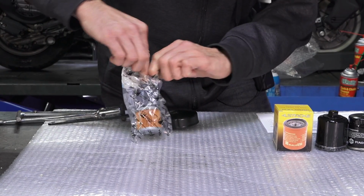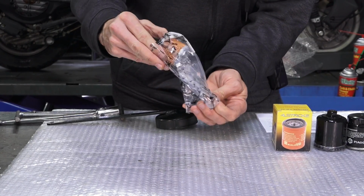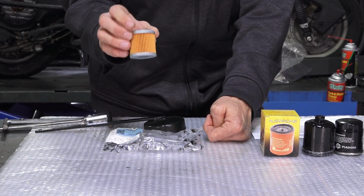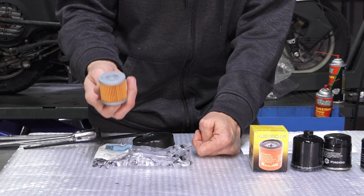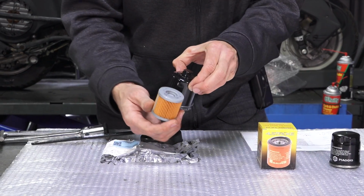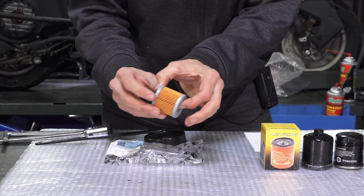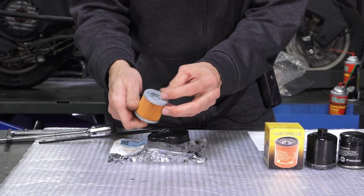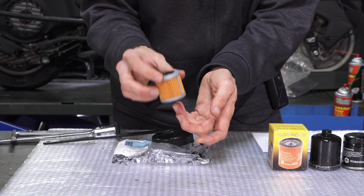Part number for this oil filter is A80887, and it's located behind a cavity or little aluminum door that's held by usually 3 screws on the BV350, and in some cases even a threaded cap. So essentially this is what's inside a filter like this. It's just the cartridge. The reason many manufacturers use a cartridge is that it's less waste. It is a little messier to change, and I think it's cheaper to manufacture because it's just the internal cartridge.